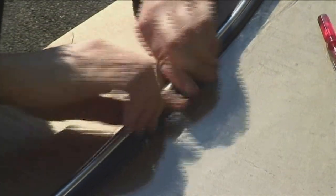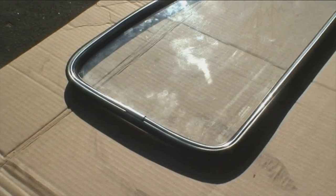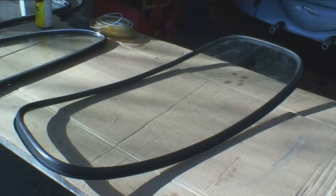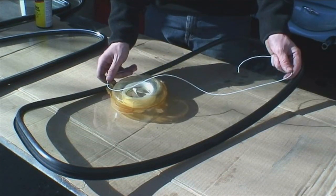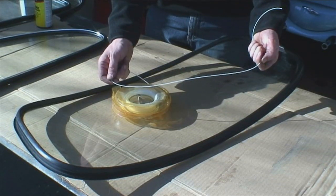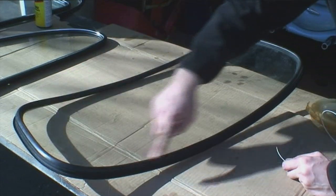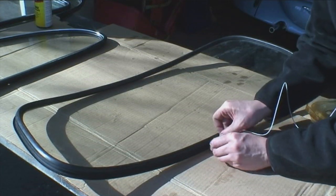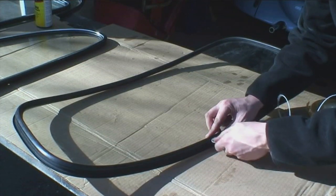The side windows will have the chrome joining section on the flat vertical section of the window, and the fused section of the seal will go in that spot as well. Now once you have all your windows with seals and chrome, I usually get some weed whacker line — you can buy these at any lawn and garden store or even Home Depot. I usually start at the bottom and work my way all the way around back to the bottom again. At the bottom you get a crisscross of the lines, and I make a bow in the line and work it into the seal to get it started.